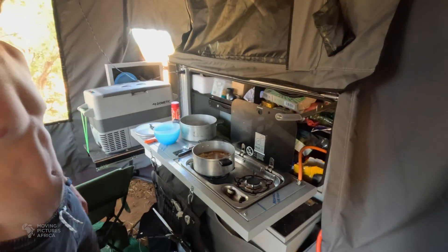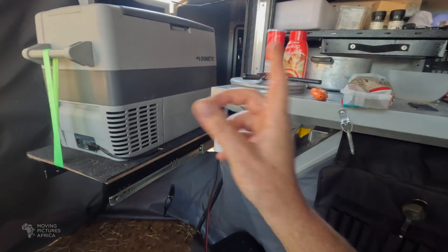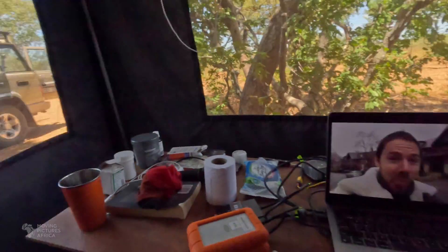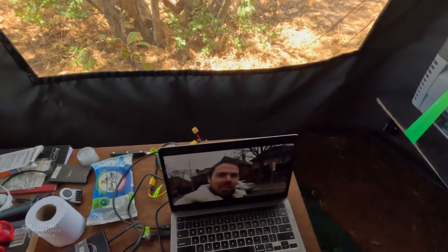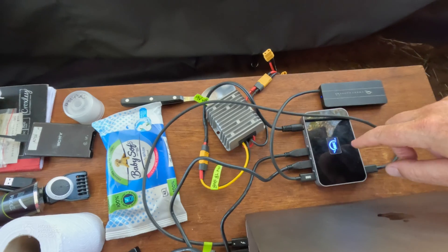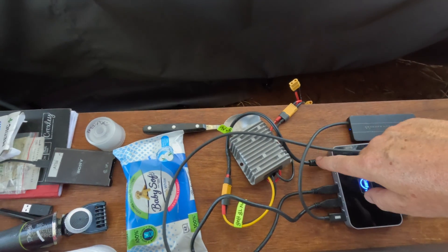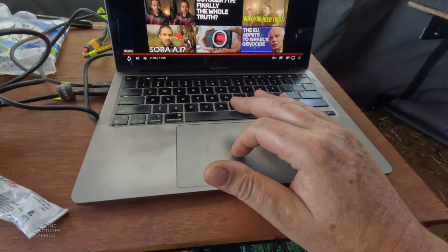Jordan's making us some two-minute noodles for lunch — very nice, thank you Jordan. What I've got here is my third lithium battery. I've got one in the trailer that runs the fridge and everything else, one in the vehicle, and this one I move between the trailer and the vehicle. Currently I'm using it to power my laptop, and rather than run an inverter I've got a little USB hub that also powers the laptop — it takes 19 volts — so I've bought a little 12-to-19 volt converter with the correct barrel connector, so I don't need to turn on an inverter to charge my laptop. This saves quite a lot of power in this case because the laptop doesn't draw much, so the overhead from the inverter is more significant. The Starlink pulls sometimes over 100 watts, so the overhead from the inverter will probably be less significant, but we'll see the results once I've completed the test.